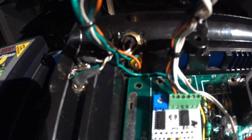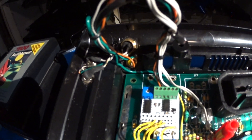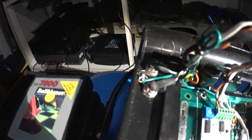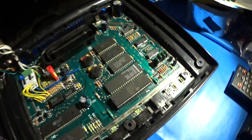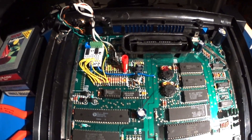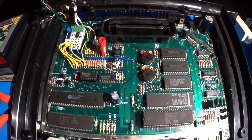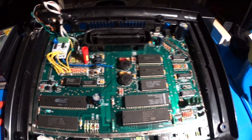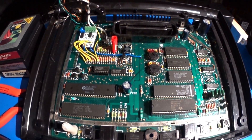That's about the best I was able to do without resorting to other locations where people add jacks, usually to the bottom and side of a 7800 case - I was never that impressed with that. I've always tried to keep connections on the back as much as possible, but with the audio it just wasn't possible so I ended up putting them on the top of the deck lid. You can see the S-video and composite right there on the back. Really happy with this - I'll take additional video footage to show the quality of composite and S-video, as well as some still pictures for close-up details of the installation. Stay tuned!